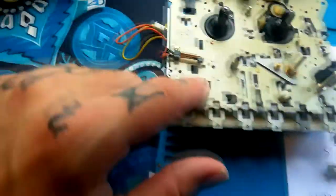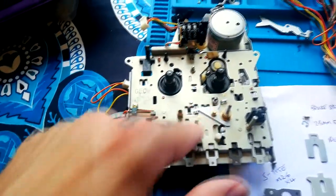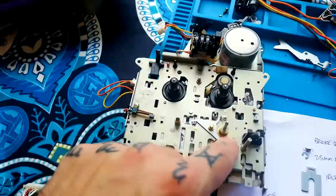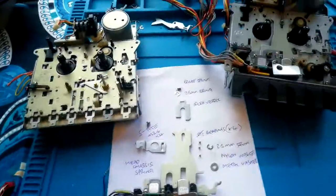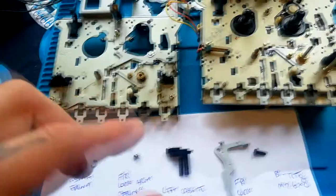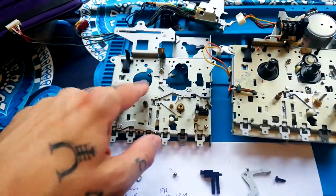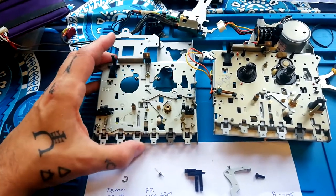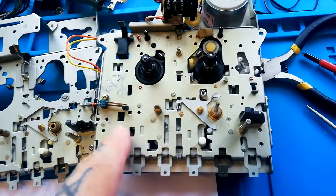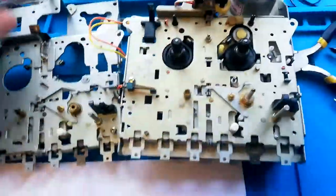Once removed, take off the old orange grease from all the places where the bearings were using isopropyl alcohol, allow it to dry, then put on fresh silicone grease. I've heard of people using lithium grease — I've never used it myself but all reports seem to indicate it's a good alternative. Put things back in the reverse order. This metal piece is called the FR lock arm according to the Portra 1 service manual. Here's a before and after: this is the Portra 5 partly disassembled, and this is a very disassembled Portra 1. These two buttons would be rewind and fast forward.